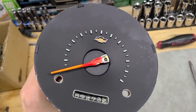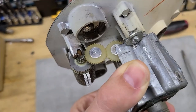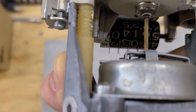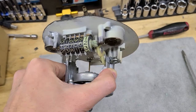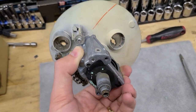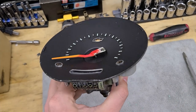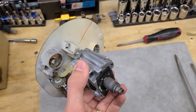Main assembly inspection: looks pretty complete, no obviously busted gear teeth. Trying to turn the worm gear by hand but it's not moving. Testing with the end of a speedo cable - trying to turn it counterclockwise and it's not responding at all, just resisting. The assembly is not too tight, it should for all intents and purposes be working. This confirms something is binding inside.